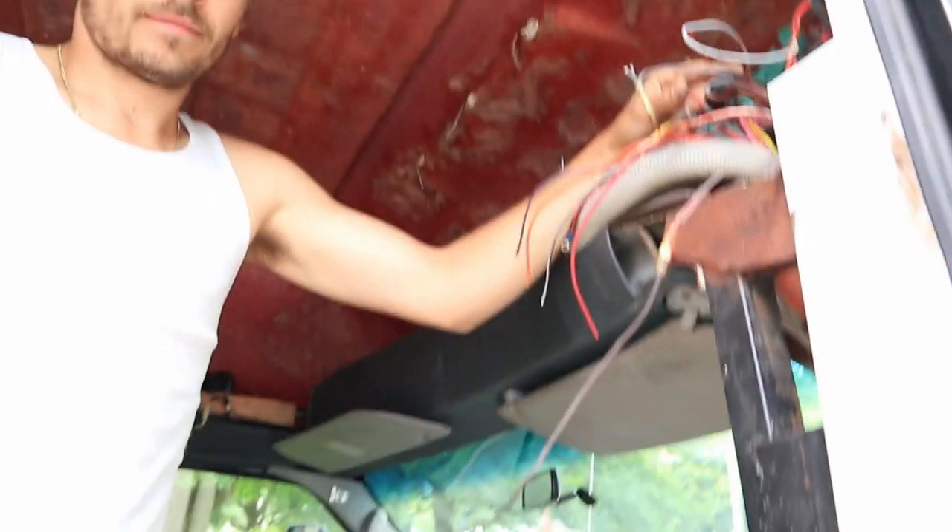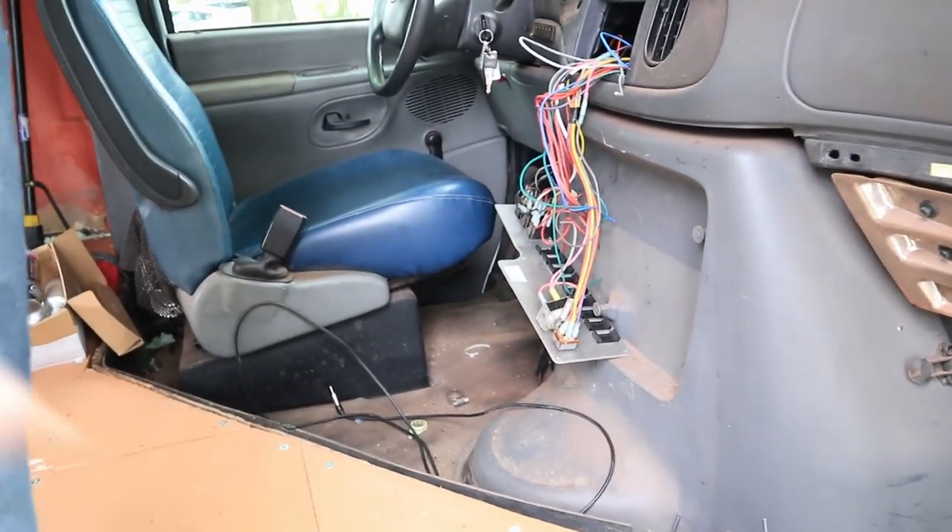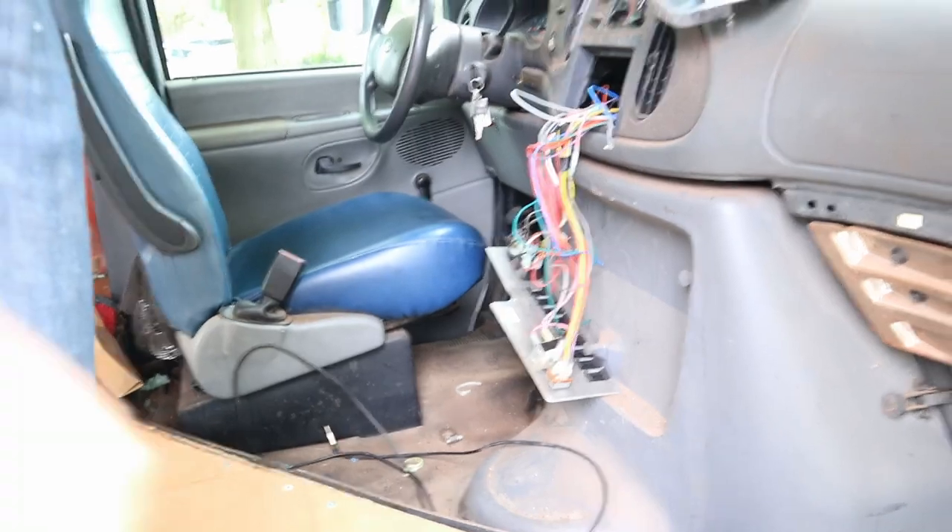We thought, hey, what do you think of this? Because intuitively we were both thinking, what other vehicle has a secondary distribution panel? And the secondary battery — why is it there, why do we need it? We don't have any wiring diagram. So what the mechanic suggested was: if you don't have a diagram, go one by one — unplug one wire, start the bus, see if it works, see if it did anything. And go one by one to see exactly where they're all going. Because some of the wires were actually not connected to the panel — some wires were already cut before we even bought the bus.